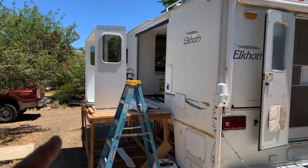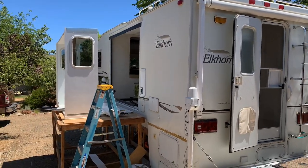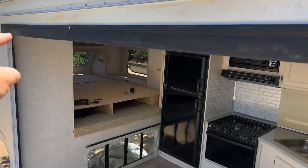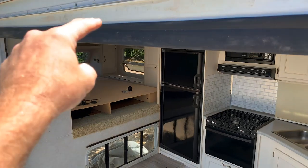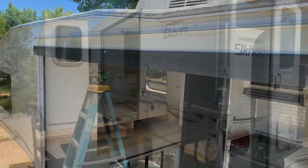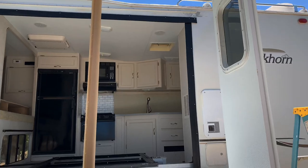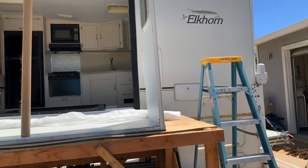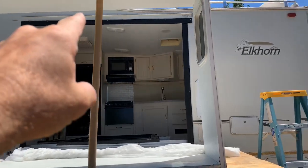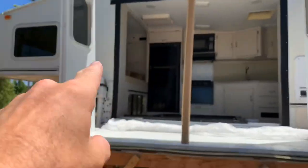I think that's going to be a much better way to do it. I'm going to throw a couple of self-tapping screws on the outside edges just to hold it in place and then get my side pieces in. After everything's all in, I'm going to go along the top around all the edges with some Dicor non-sag. All the new wiper seal is put up with the overlap — I used adhesion promoter, then peeled the 3M backing off, and it sticks really well. I also went along about every foot or so with stainless steel screws into the frame for extra security.